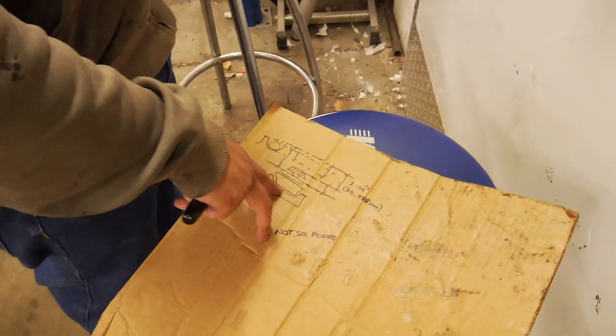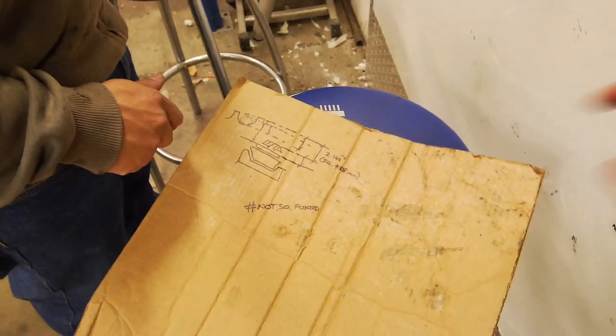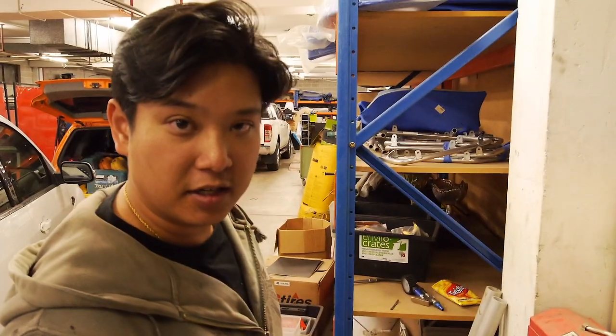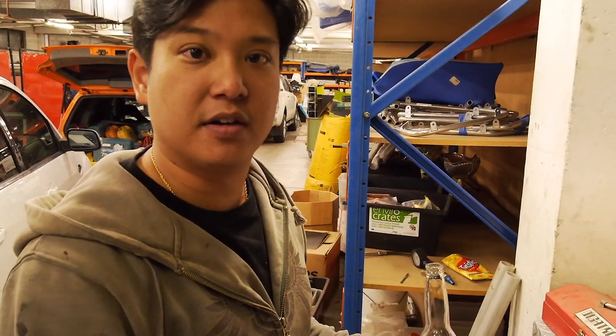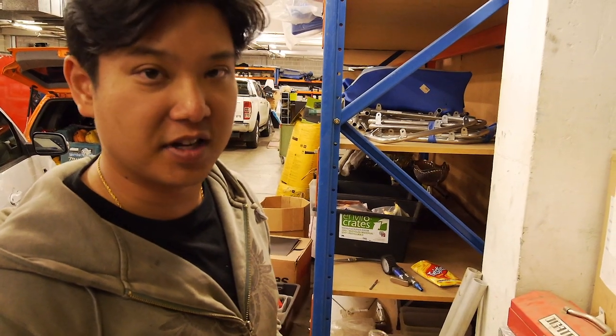Yeah, that's real bad. Yeah, try not to destroy it, because normally you cut these off. Yeah, I actually tried to get my split bearing puller around that, and I could not do it. So you want to be really careful with that. And also, if you had the shims under the cup, it's really easy to push the cup out, shim it, and reassemble it again. And there's plenty of height, so I'm not sure why they don't do that.